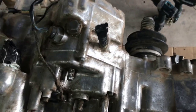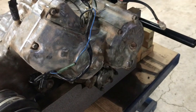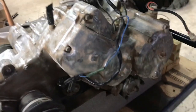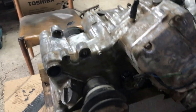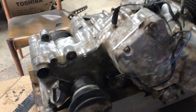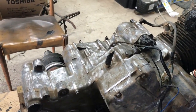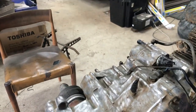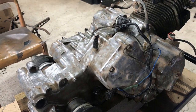I've had the oil filter out and the strainer out. In the end there had to be at least two and a half litres of oil in it. No metal fragments to speak of, so that's got to be a good thing. I'm going to get a new crankshaft seal and hook up the wiring loom — hey, this is a bit more fun.